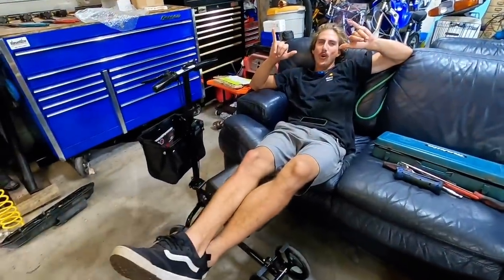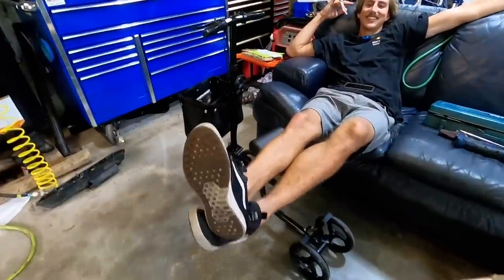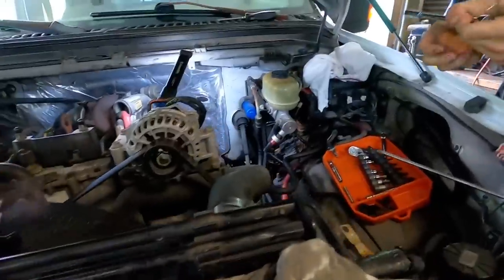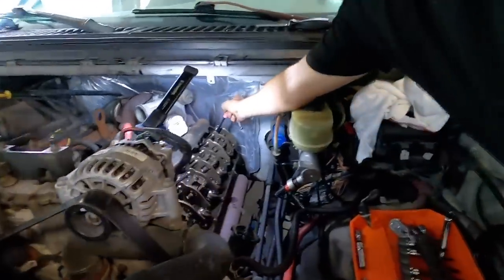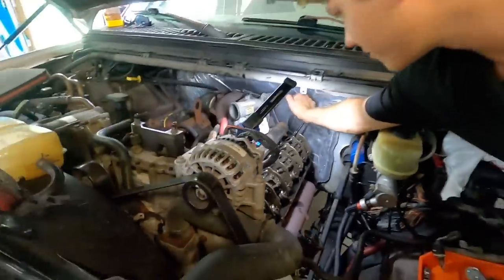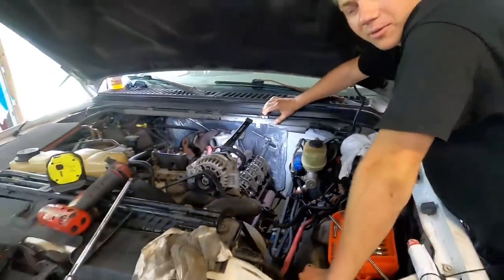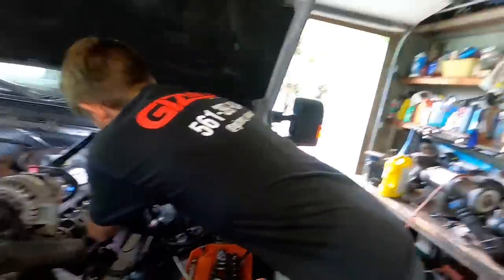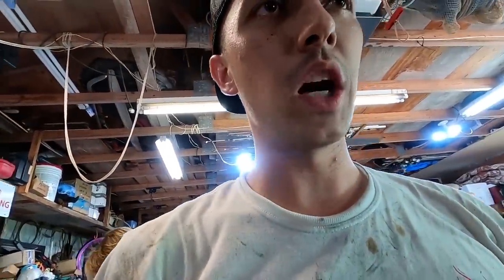It's been quite some time but we have made some sick progress. We got Tim joining us — something happened to his foot so he's got that scooter. Here's the man himself — Frankie! Right now we're just putting a bigger injector in there and swapping out all the glow plugs too. Figured might as well do that while it's all taken apart. That's good practice. The new glow plugs are Motorcraft — I believe they're 10 millimeter — and they go in pretty easily and come out pretty easily.